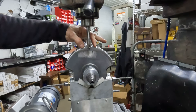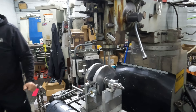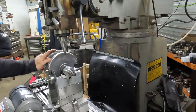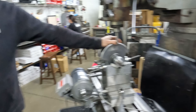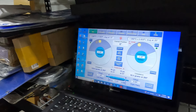It ain't quite centered, but it's close — really close. We'll end up having to put two small pieces on either side of that big piece. Over here we'll have to put larger pieces — probably half-inch pieces on each side and then one-inch slugs on each side. Supposedly both of these cranks were balanced to the same bob weight, and we've got — we're within six grams on the right side from one crank to the other, but on the left side we're 27 grams different.